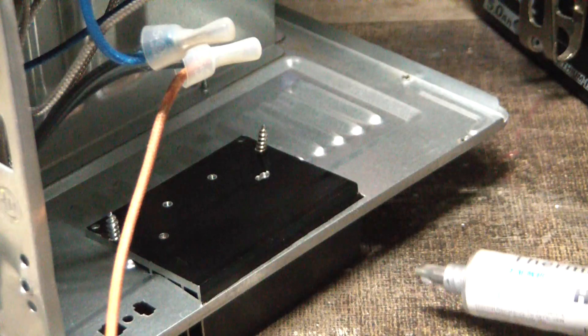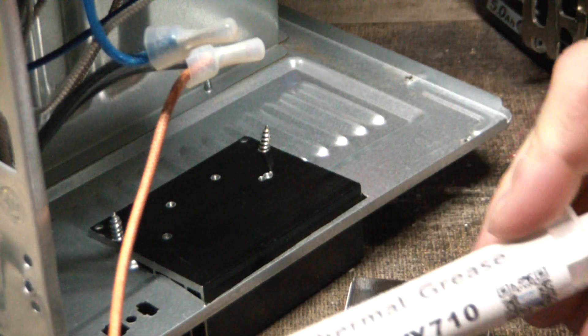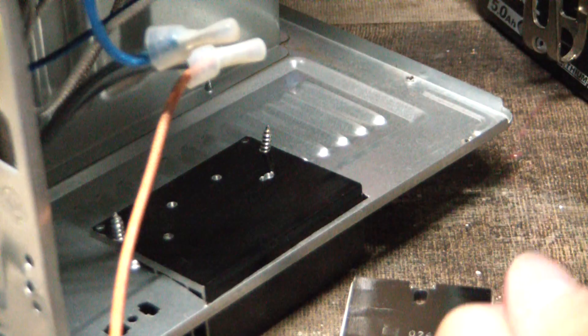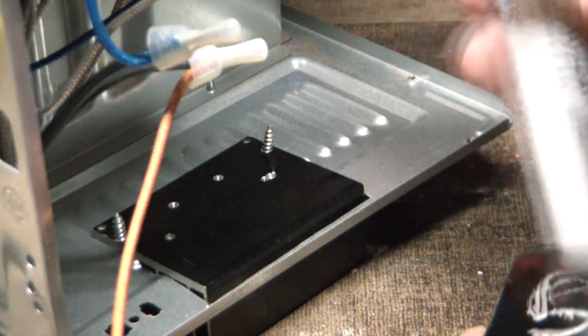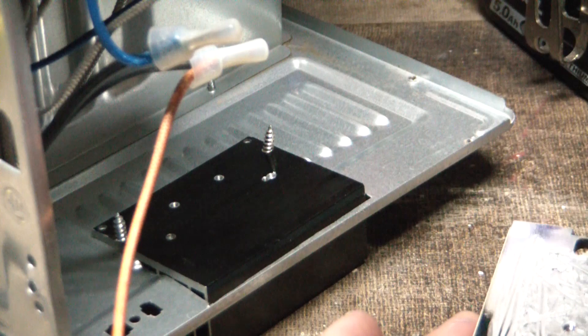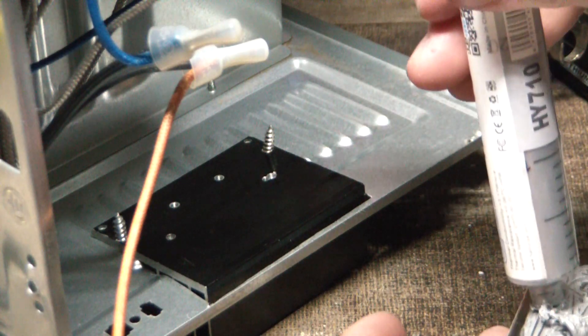I've got to put the PID back in there — I was cutting all these holes out so I didn't want shavings to get inside the PID and short something out. Got the SSR in there, mounted nice and beautifully, heat sink exposed on the outside. It'll still be hot in here even with some insulation, so I'll probably have to put a computer fan to stop stuff from overheating, but at least the solid-state relay will be exposed to ambient outside temperature via the heat sink. I applied some cheap Chinese thermal compound — it's probably just re-bottled anti-seize. I think Linus Tech Tips would be very proud of that grease application.